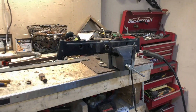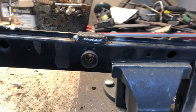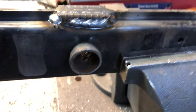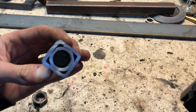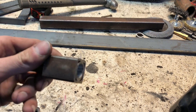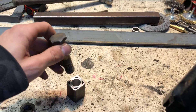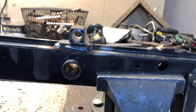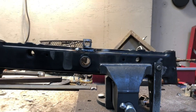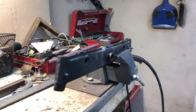I've made some progress on Nick's front axle. As you can see, this is where I'm going to be placing my articulation point. I welded in a couple pieces of rebar and then flattened it out, and then I made this piece which is some one-inch square tube and then some three-quarter inch round tube. The original bolt slides in there - super tight fit. Then I'll build some gusseting and trussing around it to make it look nice, and then Nick's got a new front axle.